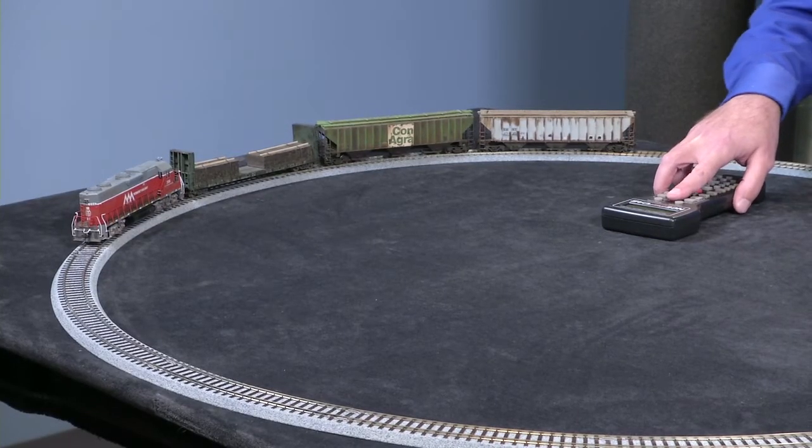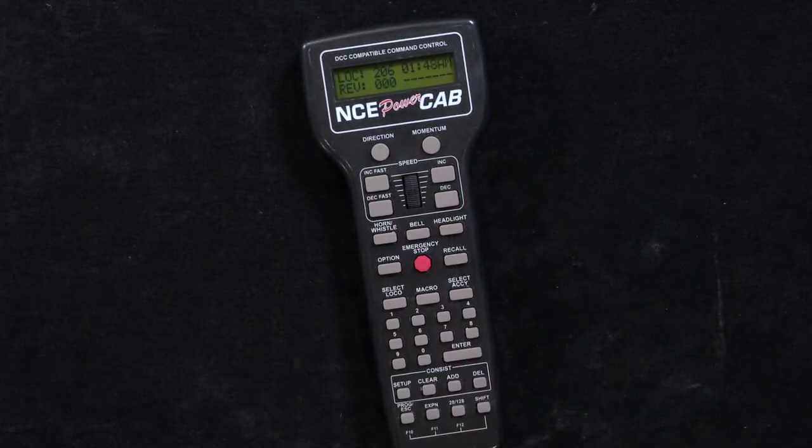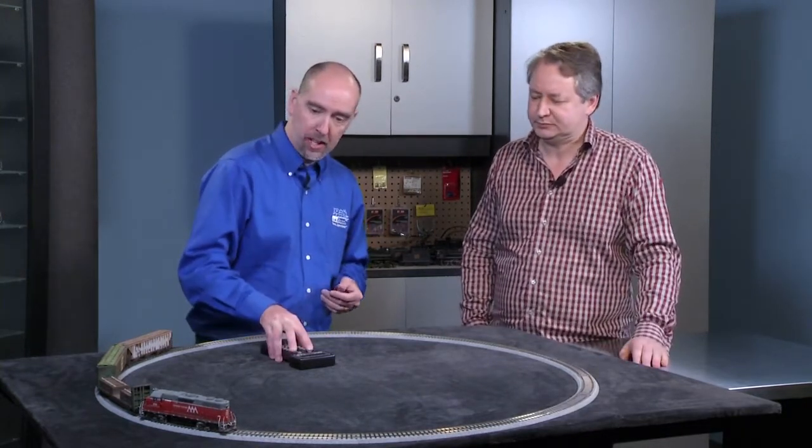In notch 4, the air compressor goes into its second stage and it pumps a little bit faster, so I can get through the train a little quicker. After notch 4, there's not enough volume in the line, so you're not going to gain anything. It's just making noise in a sense. But okay, now my air is pumped up, I can bring that back down. That's something that is difficult to emulate if you don't have the ability to separate the engine sound from the actual motor movement. Sure. So now we've got our air pumped up, everybody's back on the engine.